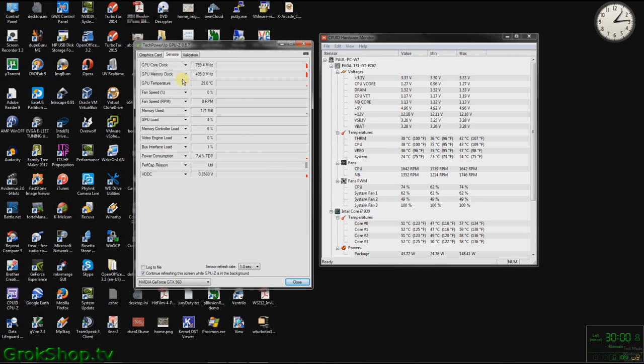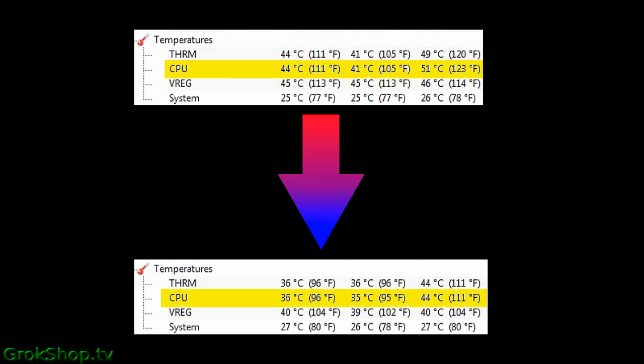So it looks like now we're running about, call it 36 to 39 degrees on the CPU measured at the motherboard, with 50 to 54 degrees Celsius core CPU temps, and 29 now on that GPU temp. And remember, these temp drops are with the 1 degree headwind. So clearly a large drop in temperature for the motherboard, CPU, GPU.